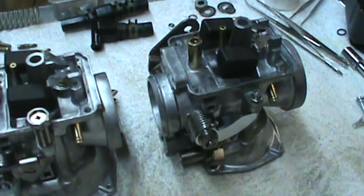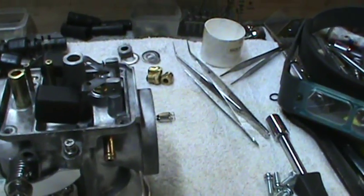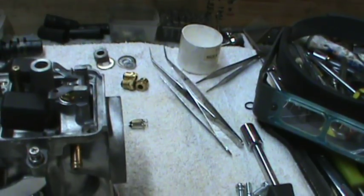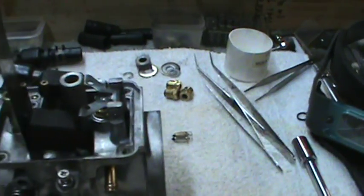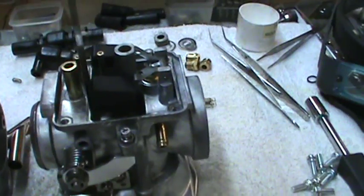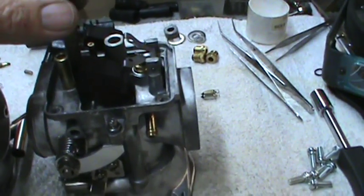Okay, this is my needle valves 4 video. What I'm going to show you here is I use the 2.0 needle valve seats with the new K&L needle valves. And what you're going to run up against is this right here. I got a ruler in here to show. I try to put it straight up, and you can see the float's going to drag.